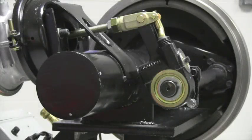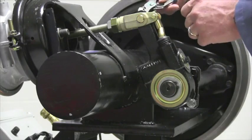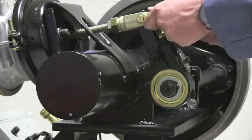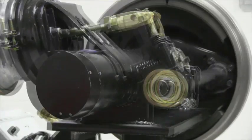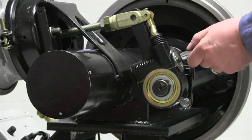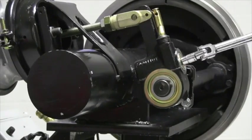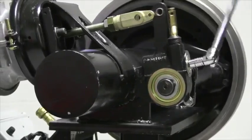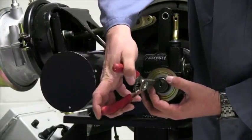Let's take a look at the installation techniques on a trailer axle. This time we'll be installing a Haldex AA1 design. We'll start by removing the cotter pins and the clevis pins. Rotate the adjusting hex counterclockwise to rotate the brake adjuster out of the clevis assembly. Next, remove the snap ring and the brake adjuster from the camshaft.